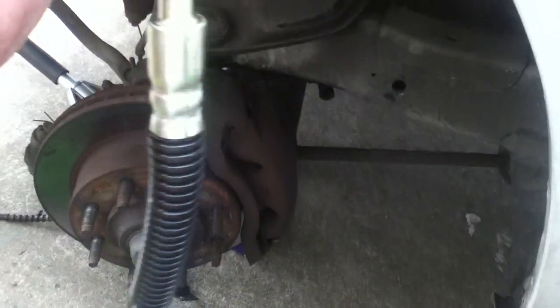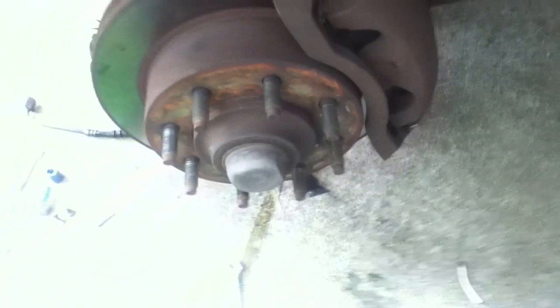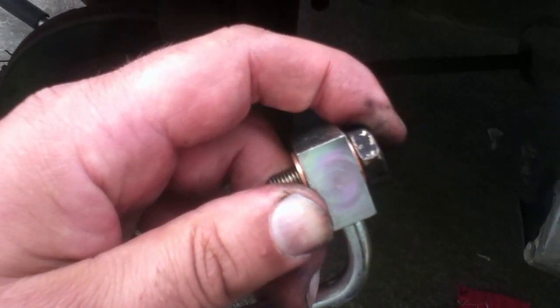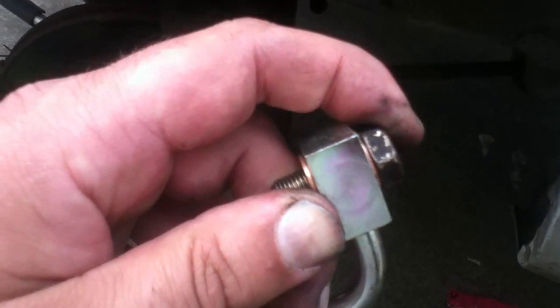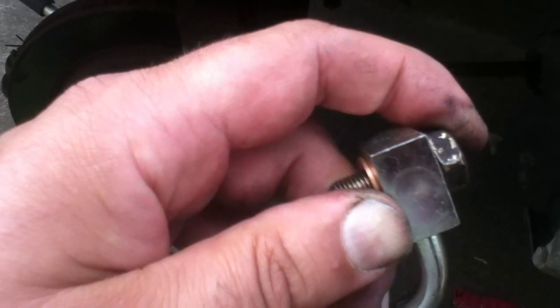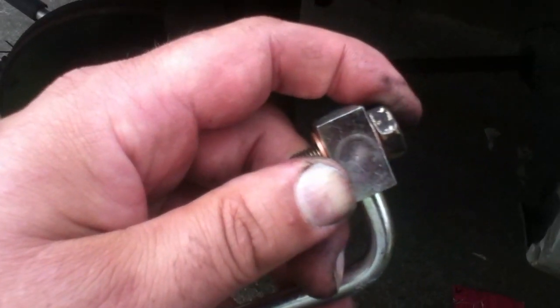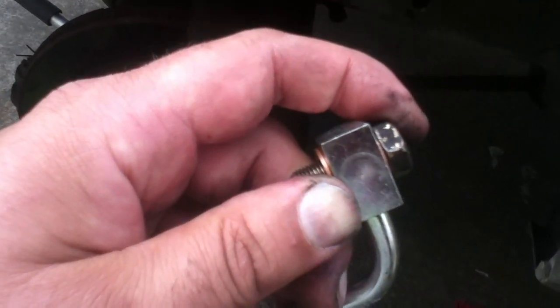So these go basically one high, one low, as it goes into that little position down there. And once they get crushed into their spot, that's it. So I'm just going to put it in loosely initially to get everything else done. It's the first thing to get tightened and the last thing to get tightened, because I'll tighten it just a little bit, but not crush the washers. And then after everything else is together is when I really crank it down.